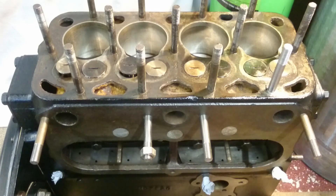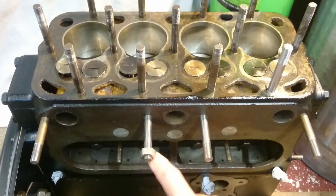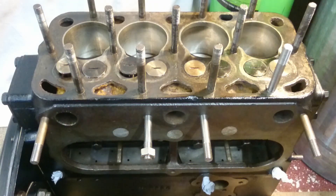A lot of mid-30s cars were built like this. So what we can see are the valves here open, and here are the exhaust ports. This port will be connected to these two valves, this port is connected to that valve, and the inlet valves are in this case connected to a port on the other side of the block.